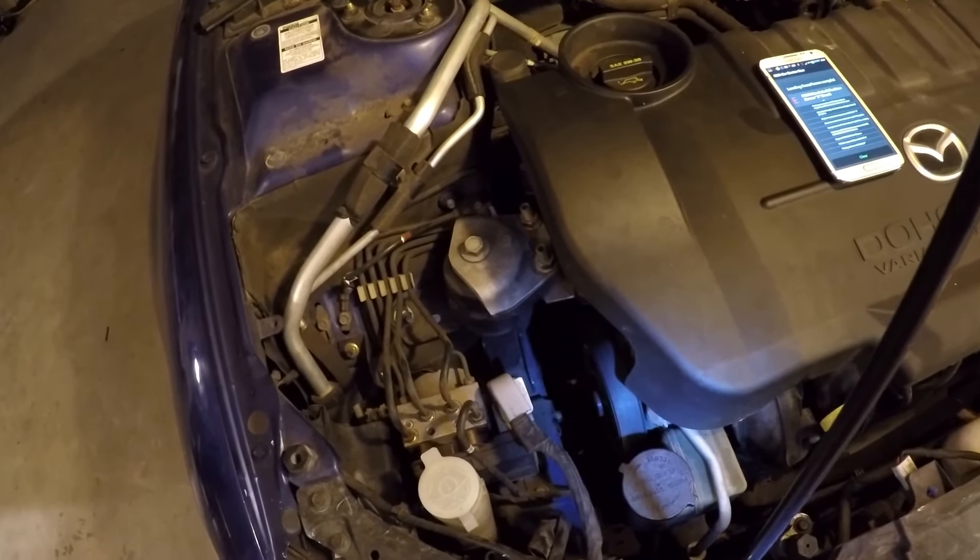Let's see what's inside the box. This is our sensor. The sensor is going to be sitting on the engine chassis right next to the crankshaft gear. The next thing we're going to have to do is jack up the car, place the car on a stand, then take off the passenger side wheel. If you do not know how to take the wheel off, you can refer to my other video called 'How to Rotate Your Tires.'